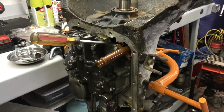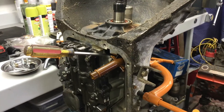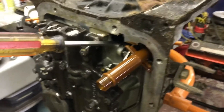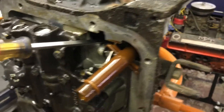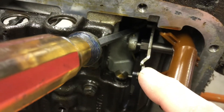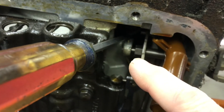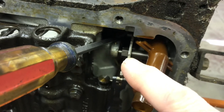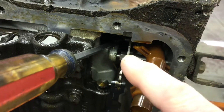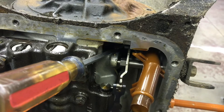As promised, we've stripped off all the outside bolts and hardware. I've broken the linkage nut loose, but I'm going to need that to get the linkage out of the case because there's a seal you need to change behind that. Where the rooster comb is for the linkage, behind it you take the nut off — you have to have the pump out. There's a nail that holds this in; believe it or not, it's an actual nail — I'll show you when you take it apart. This area where the rooster comb rides on the shaft, it's going to be buried up right there, and if you just go ahead and try to get that out of the case, you're going to destroy the case for no good reason.